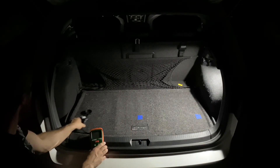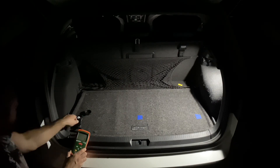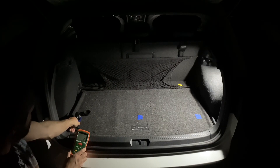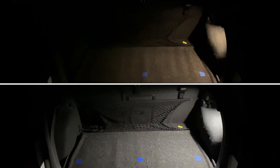Pretty significant improvements over what we saw before. On the far left side we're now seeing one foot candle — turned 90 degrees toward the light it's two foot candles, and facing almost exactly at the light it still remains at two foot candles. That is a drastic improvement. On camera you can actually see the entire trunk now instead of just a right-side yellow glow, so I'm really happy with this.